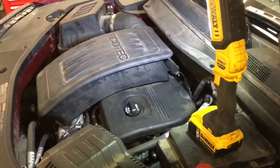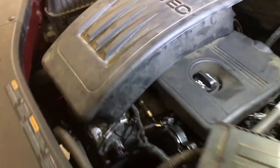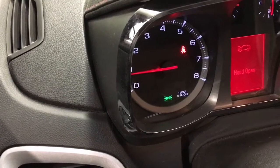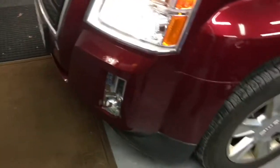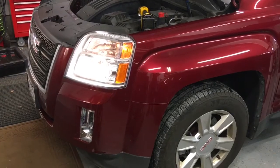If all goes well, you should now have no check engine lights — the check engine lights I had were based on the camshaft being the wrong one for the engine, because the LEA camshaft will not work with the LAF computer due to the camshaft position sensor telling the computer the wrong cam condition. After clearing the codes before starting, the check engine light is off. That's how you put an LEA motor into a 2010–2011 GMC Terrain or Chevy Equinox, and in the process you upgrade to the much better engine, which eliminates timing chain issues, oil consumption issues, ring issues, and all the other issues the 2010s had. This car has got a new lease on life thanks to the LEA engine swap.